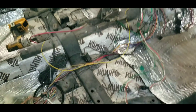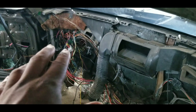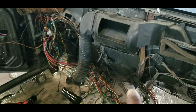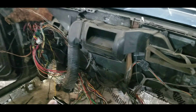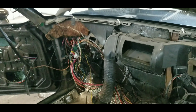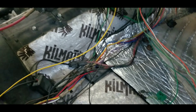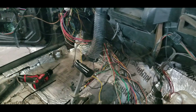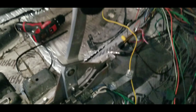But besides that, what we got going on with Patience — as you can see, the seats and things are gone, the digital gauge is gone, all you see is wires. What's happening in here right now — I'm trying to clean up all of these wires so I can loom them and attach them to the back of the dash and go ahead and permanently mount the dash. Everything under here now is pretty much finalized except cruise control. I got those wires separated so that if I ever need to run those wires, they're already set aside. Far as the lights go, I got that power wire ran, and also got all my grounds ran already back here. So that's already done. All my stereo wiring is ran here already — all that's already ran into the loom. So all that's good, everything's ran.